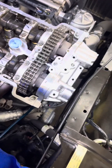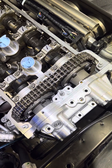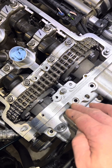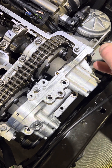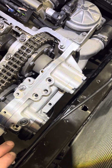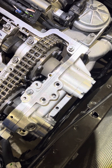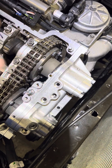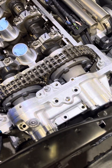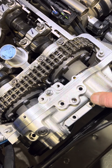The way I found that works — and there's really not much information out there about this — is that BMW in TIS recommends two special tools. One allows you to put air in the Vanos and move the pistons fully back, and the other is an electronic box that connects power to switch the solenoids on and off to move the pistons fully forward. Those two specialty tools are like several hundred dollars. That's the way you're supposed to do it on this car, because the clearance just doesn't allow you to verify the pistons are back in the bore any other easy way.